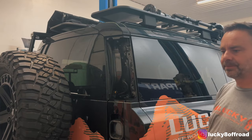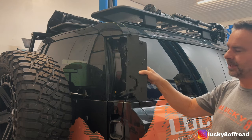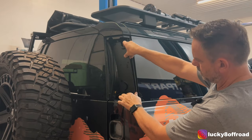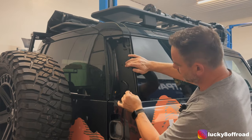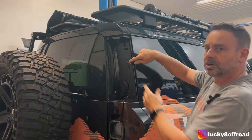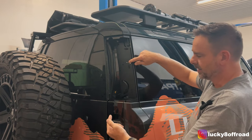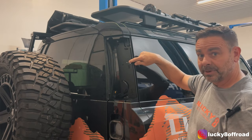With the plastic trim piece out of the way, you need to find the corresponding mounting plate. This one is easy to find because it's got this wacky cutout in it for the rubber hose here. That sits in like so. Take one of the rivets and you can align the plate — the rivet goes in the hole that the little plastic clips are coming out of. This one's got a bolt on the bottom. I'm going to take the bolt out, rivet everything down, and report back.